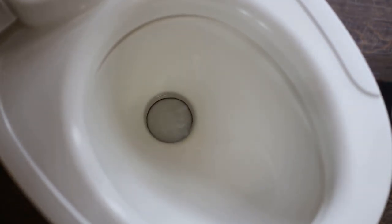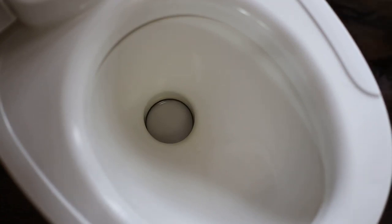That about wraps it up for the black tank. We've now got our gray tank treated through the shower and our black tank treated through the toilet. It's important to note that in the gray tank, you don't want the Happy Camper to sit there for a while — flush it pretty much right after it's dissolved and ready to go, otherwise it will solidify. If you do end up leaving it a little longer than you'd like, you can add some hot water and that'll help it re-dissolve. Just a note to take into account.